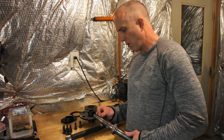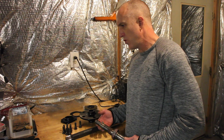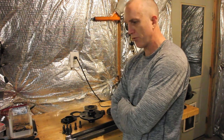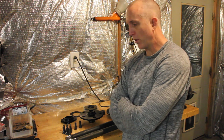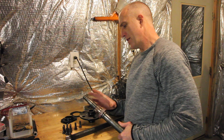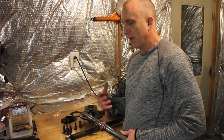One of the main drawbacks is that this Woodruff key and spline configuration with the hub isn't very strong. So if you go and make a modification to your CJ — put in like a 401 or a 360 or a Ford something — because you want to drag race your Jeep or whatever, you're going to have to change out your back axle. Either put in a one-piece axle or switch to a completely different axle. The scenario that comes along — and you may have heard somebody mention it — is that their rear hub or rear axle is spun.